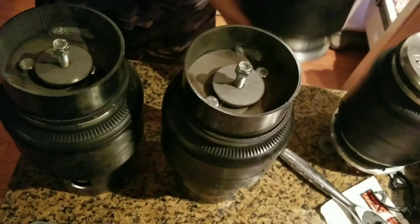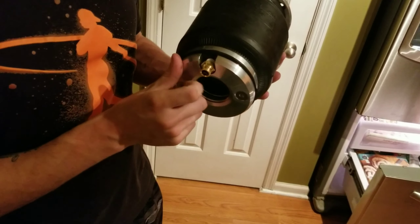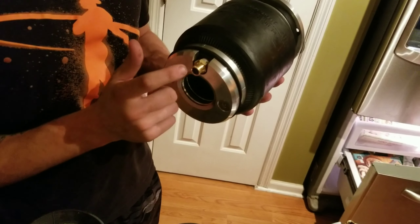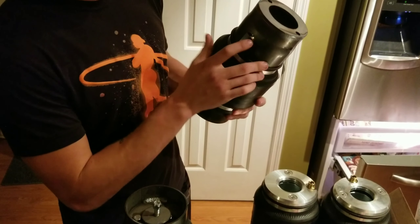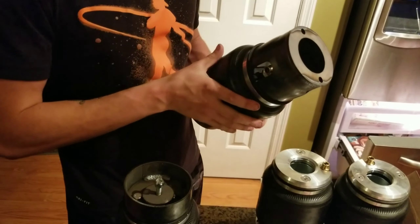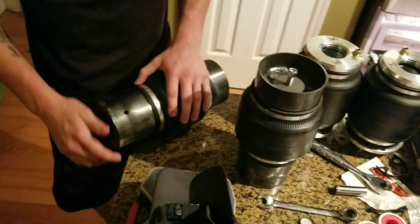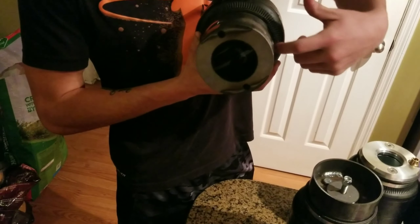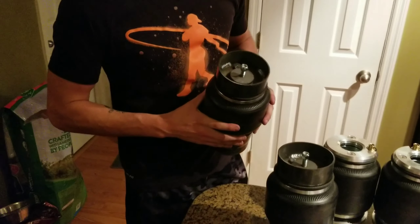These are going to be the fronts. If you look at the front of your axle strut, this is obviously the top mounting bracket and this is going to be the bottom. You're going to have two straight three-eighths fittings here for the airline to go through. We got the upgraded one-quarter inch airline. Make sure you use the straight ones on these, because these are particularly made on the rear struts for these — the elbows, because this is where it's going to be mounted, so you can't use those there.